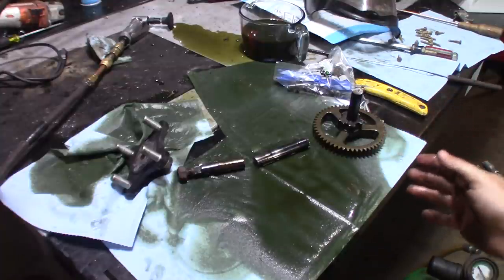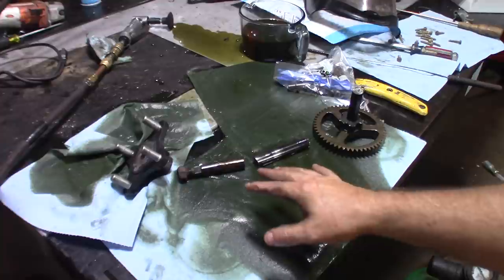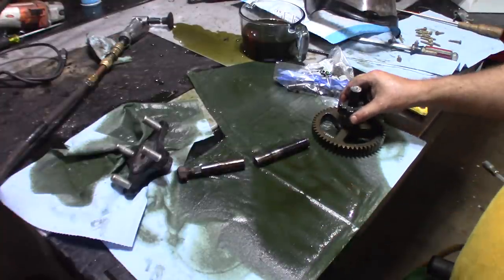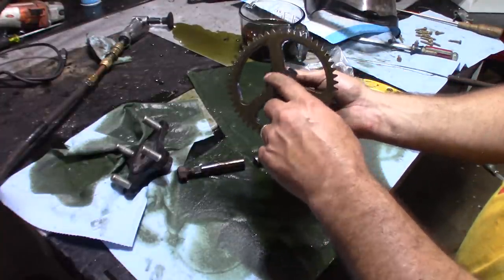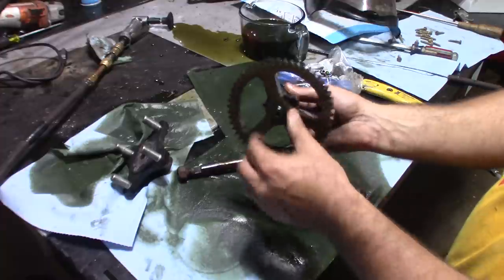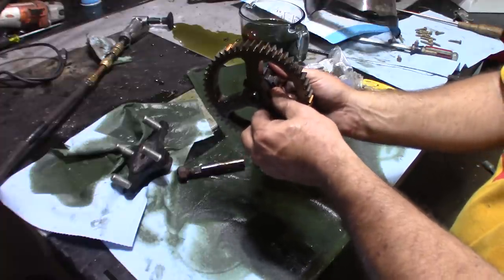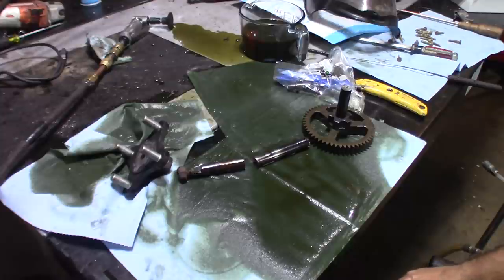Hydro-Gear is a problem with these things breaking. So I know they have an upgrade kit to 1 inch. So that's probably what I will do. This one, there's a snap ring and a spline. This one will come out because it moves in here already and it was submerged in oil. So that shaft is all I really need to replace. Hopefully they sell that. If they don't sell it, I'm gonna have to upgrade. And that's about 110 bucks.